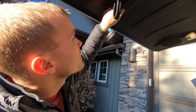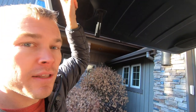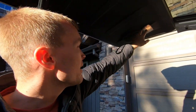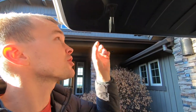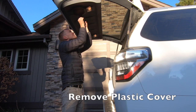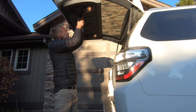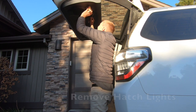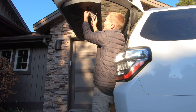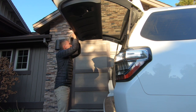With the tweeters installed as well as the front doors and rear doors, the last step is to do the rear hatch. The rear hatch isn't all that different from what we saw up front. First step is we've got to remove this little cover at the grab strap — there's a 10 millimeter bolt under that — and then we've got to remove this plastic light cover. We're going to use that little pry tool or the screwdriver to gently pull that out, same over here on the driver side. Once we get those both pulled out, then you're going to disconnect the electrical connection, pull those fixtures out. And then the whole panel removes just like the doors did, pulling up the bottom and the sides, and then the top last.